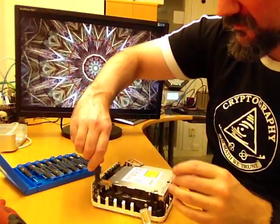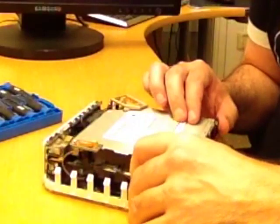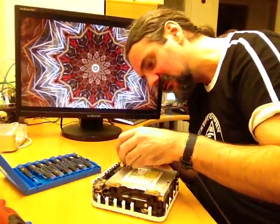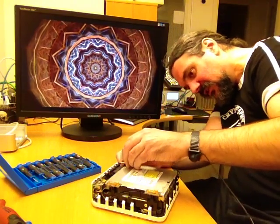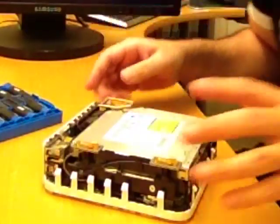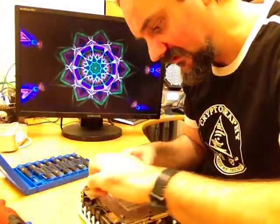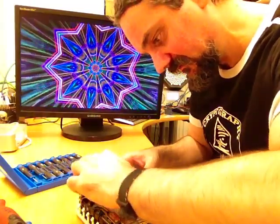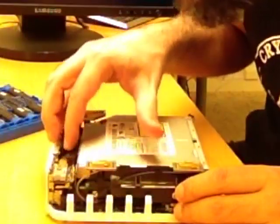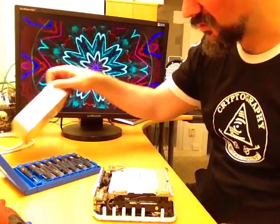Now — perfect. The hardest thing: put the antenna cables back. Click that one, click, and it should go a little feathery like that. This one has to push a little bit but not too hard. Putting it back — it should feather a little bit. And don't forget to put back the sound cable. That's actually not so easy because you have to push and get it straight up. Now it's in place. We should have sound too if this thing boots up.